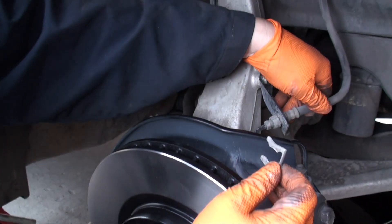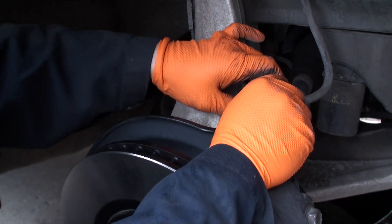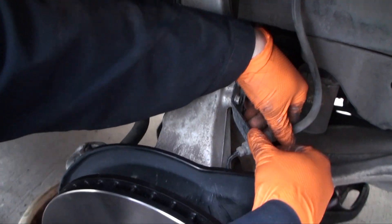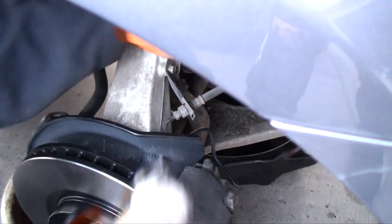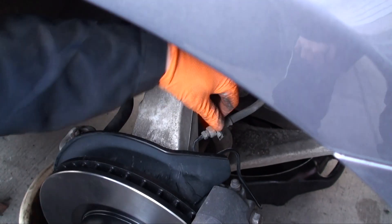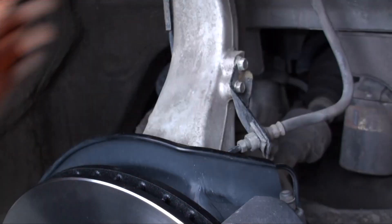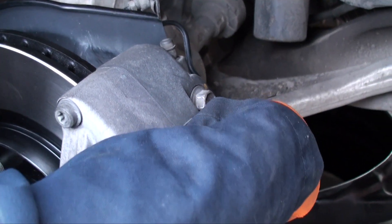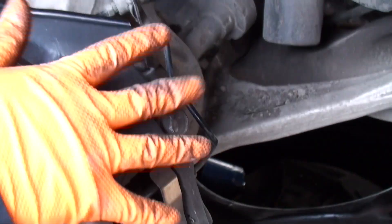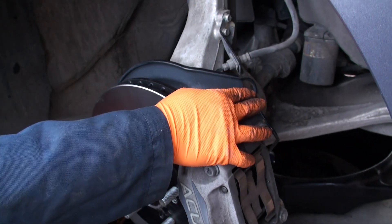We want to make sure that we don't forget to re-secure the brake line with the clip that we had removed earlier. To reinstall this, there's a groove on our brake line that we want to press up against into this bracket and then slide this clip on. It'll be a little bit tight — push it on and then using a hammer, carefully tap that clip back on and then use a screwdriver to finish driving it completely down onto its seat. Give it a good wiggle to make sure that the brake line doesn't move. Also make sure that we inspect this brake line to confirm there are no kinks that we may have accidentally put into the line. If everything is good, what we want to do next is bleed the front brake calipers prior to putting the wheels back on, which I won't show in this video — you can see it in another video.